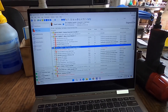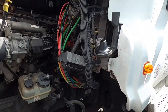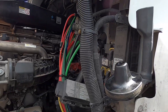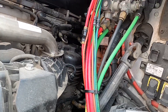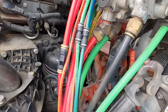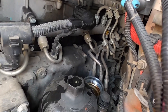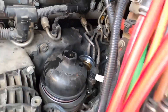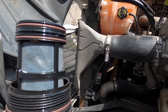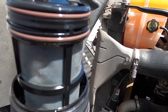So that's what we found. First, get all the accessories out of the way — visor, rain catcher, wiper blades, air filter. I'm going to pull up the filter to show you what we saw last time this truck was here and confirm that yes, the pump is bad and has to be replaced. If you're pulling out your filters and inspecting them: if you have a two-filter system it'll look like this; if you have a three-filter system there'll be two filters plus a small one on the side.